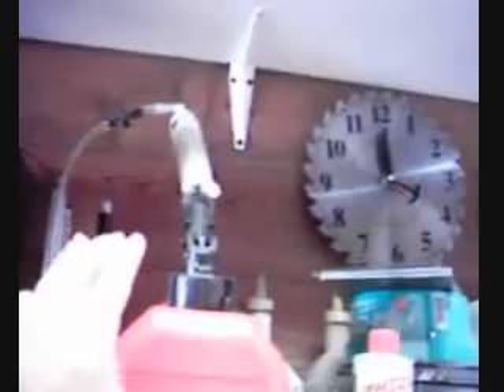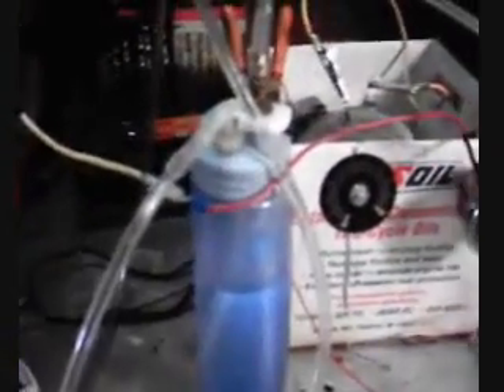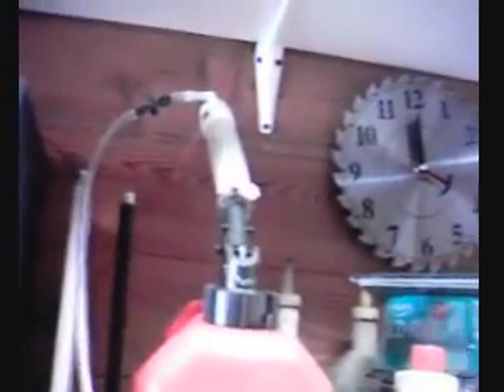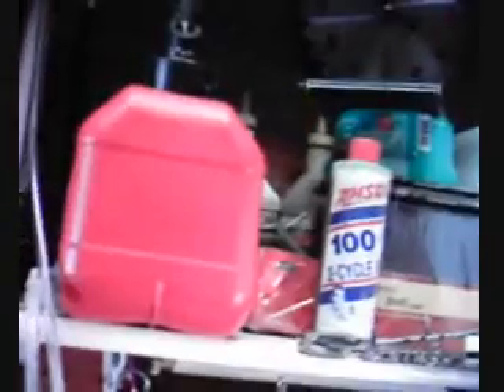I have a check valve up there to stop water being drawn out of the bubbler. This is connected to the bubbler down here. You can see the bubbles coming up and I've got a little neon light behind it so you can see it better. The long neck with a large hollow tube will prevent it siphoning electrolyte out of the unit towards the intake. And if it did happen to get a little vapor, the bubbler would catch it right here.